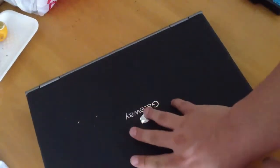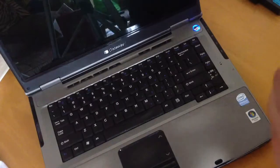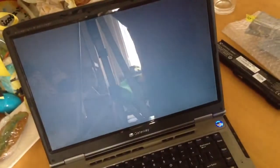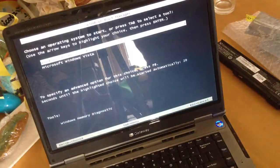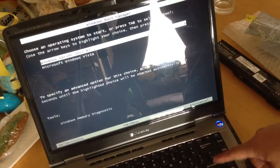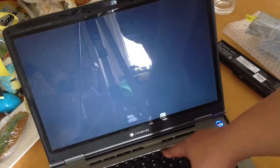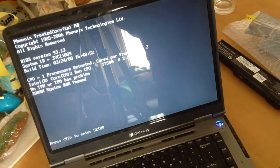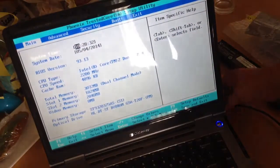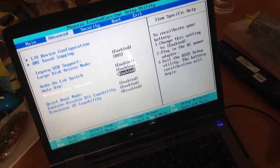And you should try to charge it. It'll actually let it boot up on its own. So right now the battery runs just fine. I wanted to go into BIOS because this thing has a battery learning setup I mentioned in a different video. If I go into advanced, scroll down to battery learning, and I enable it, I might want to do this for a new battery.